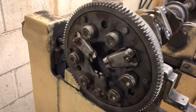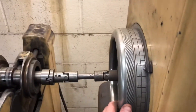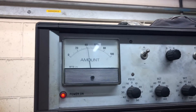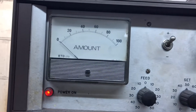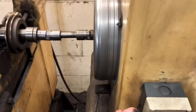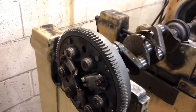We've got the clutch cover bolted up and we're going to spin this up and see how bad that is. Not too bad - it's 40 amount at 10 degrees, then the hand's going all over the shop on zero. What I did was put four holes here, a couple there, and one in the opposite side where I've gone a little bit overboard - and it's all balanced. There we go.